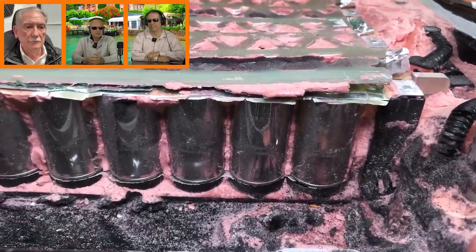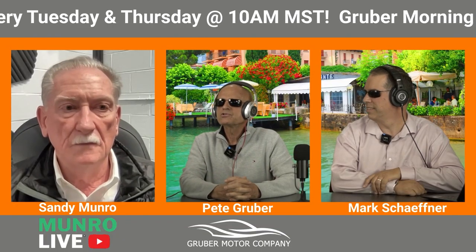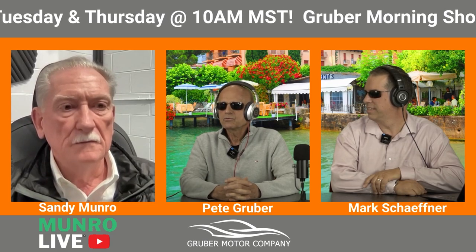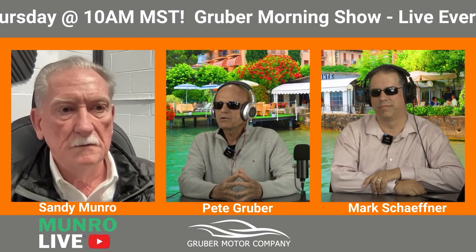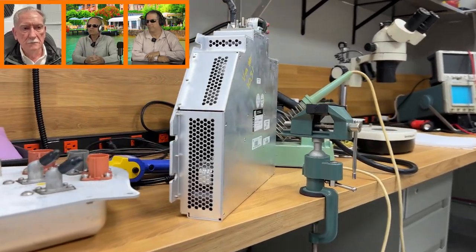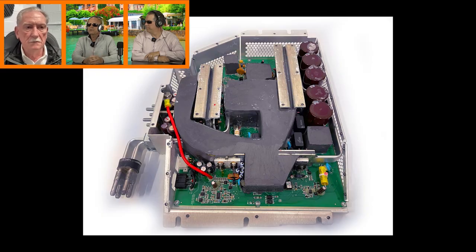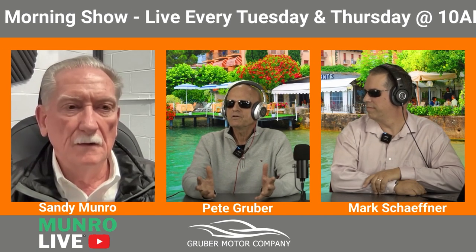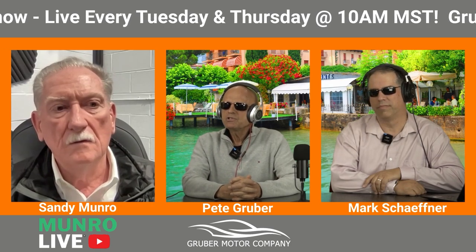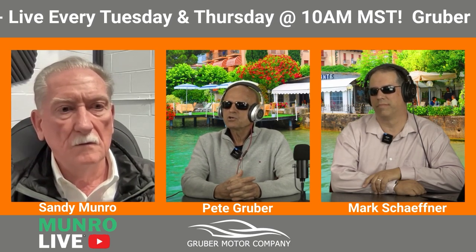In our world, we have to find a way to service things like that in order to remain in business. We did that type of thing with a number of Roadster parts. The DC-to-DC converter, for example, is a nightmare once you open it up because it's about 40% potting material. They put a bunch of components underneath the potting material — MOSFETs, transformers, diodes, things that fail. We're curious: do you see any way possible that this thing could be repaired?